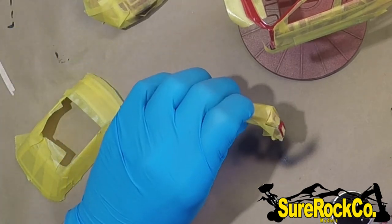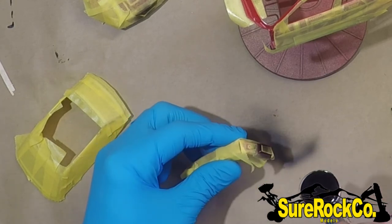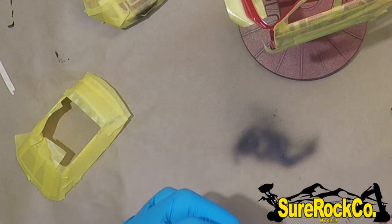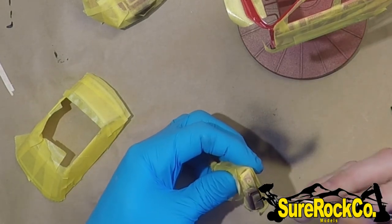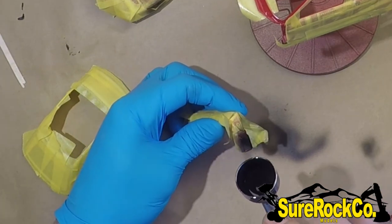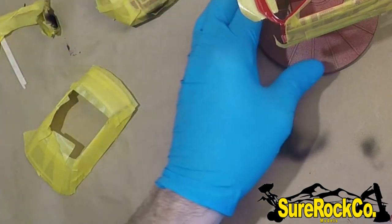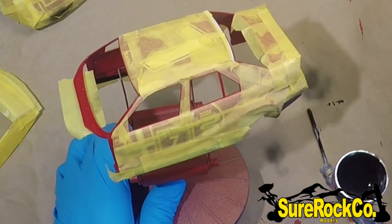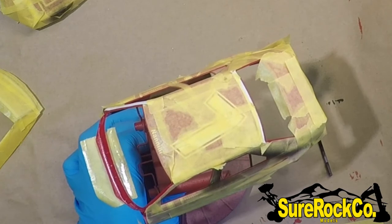Here I'm onto my masking. This is after I cleared everything and polished it again, so all the decals on there are set, they're under clear, they're polished. This is basically the final masking — any final trim pieces that require black. So I fully masked the windows, the car, everything. This is the process I'm going through now, making all the final trim pieces that need to be painted.